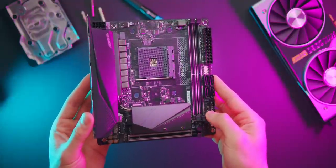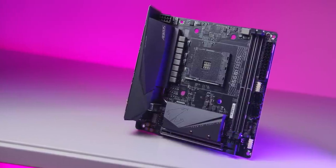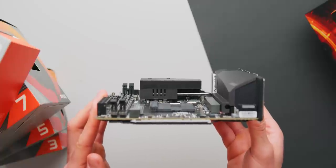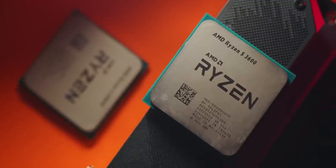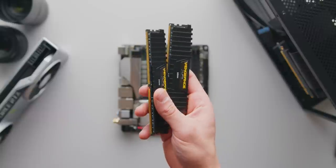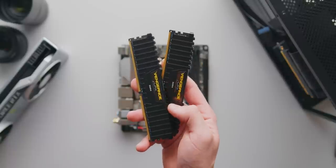VRM design on B550 is very comparable to X570, with some boards we're looking at today using 90 amp power stages. The B550 chipset also doesn't need active cooling like X570 does, so a completely fanless motherboard is an option. Compared to B450, you also have peace of mind when it comes to fourth generation Ryzen CPU support — it's guaranteed to be supported, not just attempted. Getting full rated speeds out of high speed memory is still hit and miss on B450, but you're much less likely to run into an issue with B550.